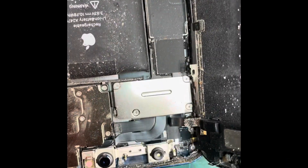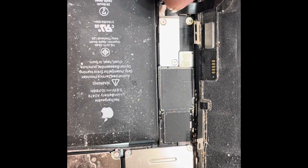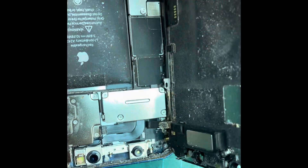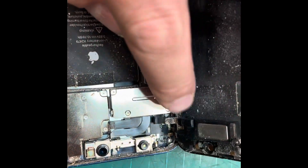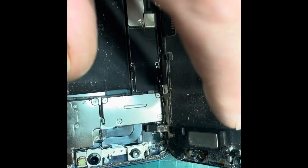We're going to release these two screws there and then those four screws there and get the plates off, and take the screen and the proximity sensor face ID off. That's the face ID camera - yeah, that's the main bit.